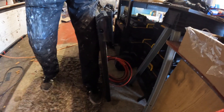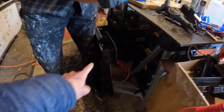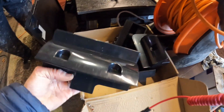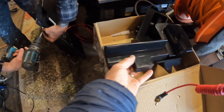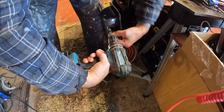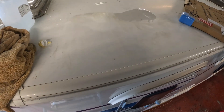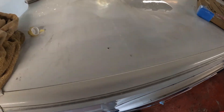We'll pre-drill the brackets, drill the pilot hole, and then the little screws just go straight through the bracket to hold it to the actual solar panel. We pre-drill with a slightly bigger drill bit first, then pop the pilot hole, and then just screw the bracket through.